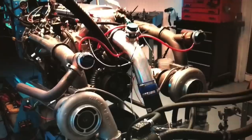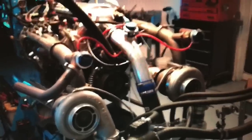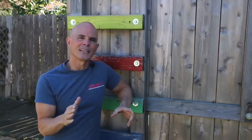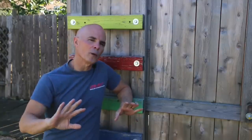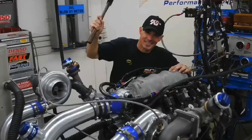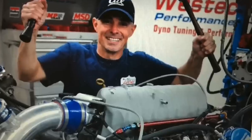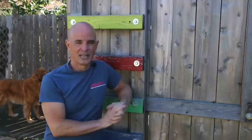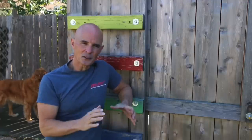This was an outgrowth of the original Big Bang that we did with the turbos, where we took a stock bottom end, added a ring gap, put heads, cam, and intake on it, then two turbos, and turned them all the way up until something broke. I did that test with a Gen 3 4.8, a Gen 3 5.3, a Gen 3 6.0, and then finally with a Gen 4 6.0. After doing all that testing, the nitrous guys screamed, 'Hey, what about us? We need some love.'